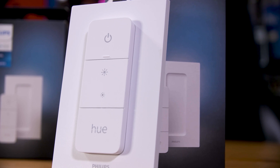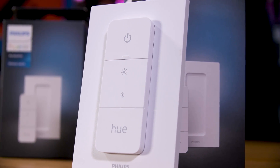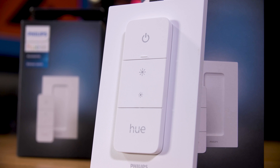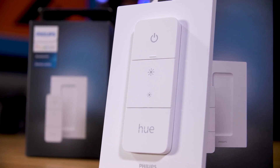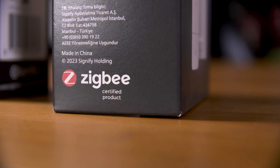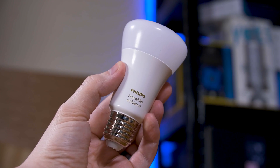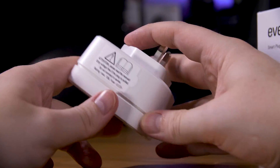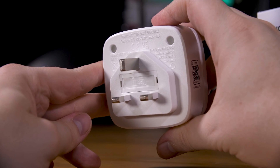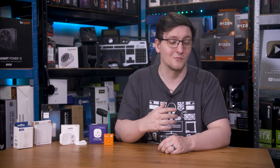As for hardware, the Philips Hue dimmer switch V2s that I got last year to replace the dreadful Moe's Zigbee scene switchers have been rock solid. They are still Zigbee devices, but they don't drop out and don't need new batteries every three months. About a year later, they're still going strong and always quick to respond. The Philips Hue Zigbee bulbs have also been pretty decent. The Matter devices — the Eve smart plug and the Nanoleaf Matter bulb — have been great as well: really quick to respond and pretty reliable, especially now that Home Assistant supports the Eve plug properly.